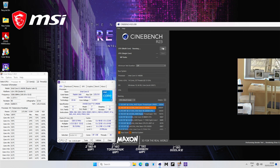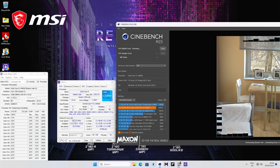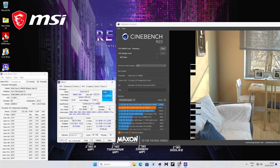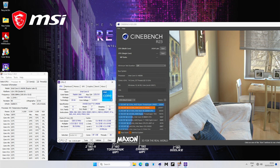Running a second benchmark to confirm: before, we hit 90 degrees on the second run. This time we're up to about 79 degrees again, with 5.3 gigahertz staying rock solid. We've got an 11-degree drop in temperatures and we haven't even started overclocking yet. We've also got a higher score — 24,341 — so we've already increased the score without even touching the frequency. MSI was absolutely right to disable CEP support by default — you're not losing any performance in Cinebench or in your games, you're just making your processor run a lot cooler.